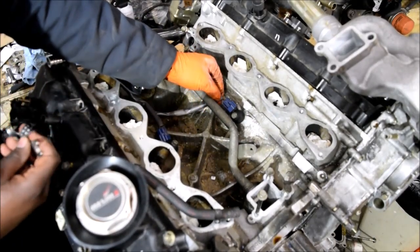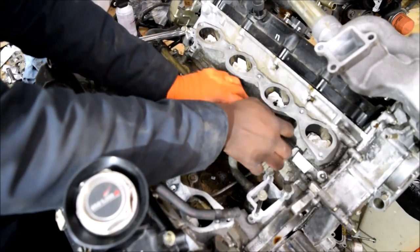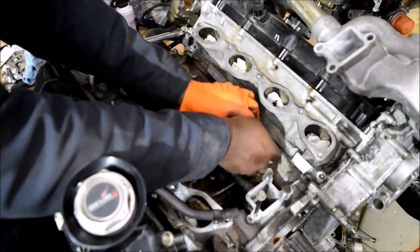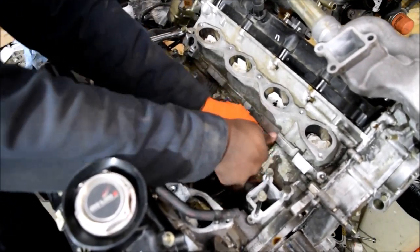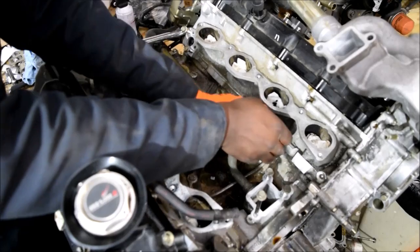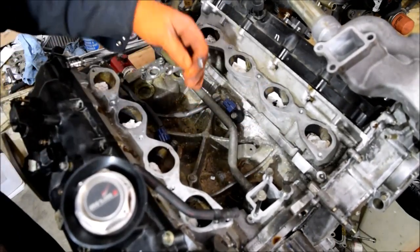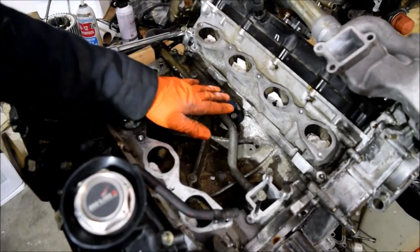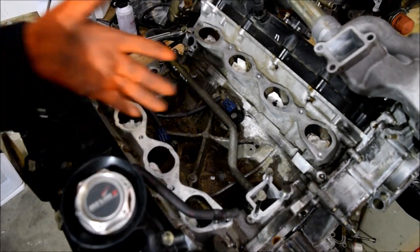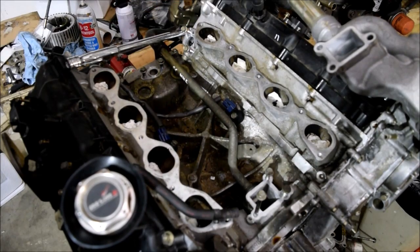I just turned it, that's all I did. And it is tight — working out my core trying to get it any tighter. So that's good. That's a sucky thing: to replace your knock sensors, your intake has to come out. Not too bad, but it is what it is. It's a V8, it's dual overhead cams — it is the best way to do it.